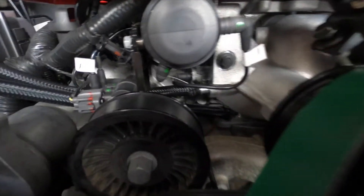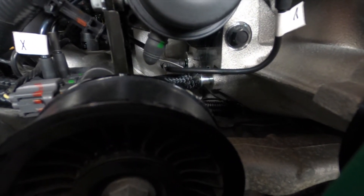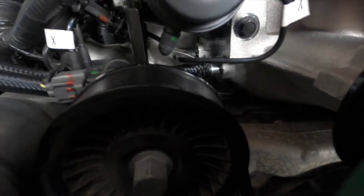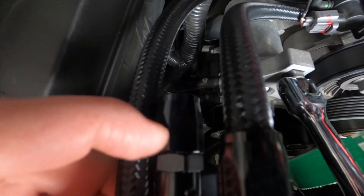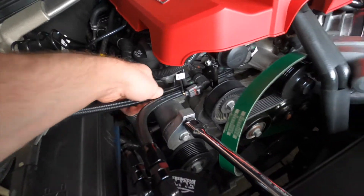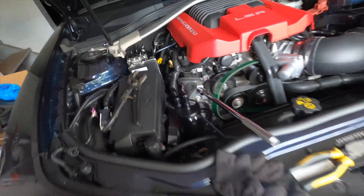So I have it attached to the engine. There's a little barb on the inlet port on the engine there — you don't have to go over that barb, just go up to it. That's where you're going to place the clamp once you cut the hose. Now that we have it attached to the engine, I'm going to go ahead and line it up with the outlet port on the can, give it a little bit of slack, and cut it about halfway through the adapter there. Now that the hose is cut, I'm going to take it back off and let that end sit in some hot water again so it's easy to put on.